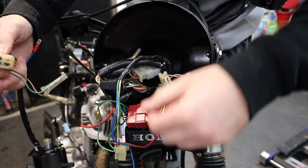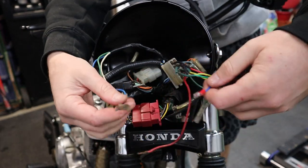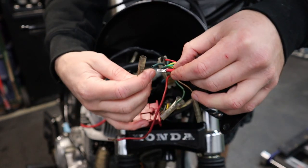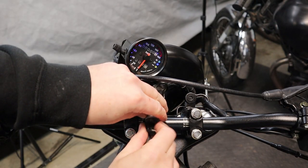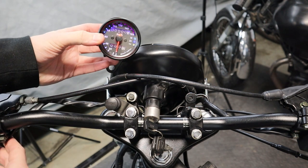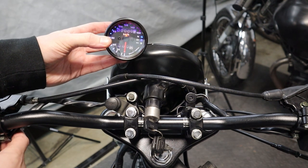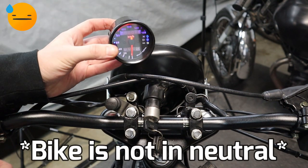Now I'm going to make sure it's all working, so we'll test that real quick. First thing we'll do is plug in the connector. This is the three-prong spin-off connector I was talking about, and this is going to go into the OEM connector like that. We'll turn my ignition on — backlight comes on, that's great. Left turn signal works, both turn signals work, high beam — sweet deal. My neutral indicator isn't working for some reason.